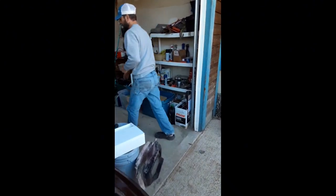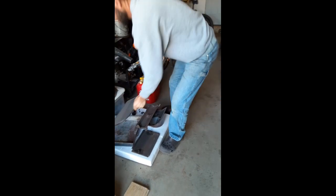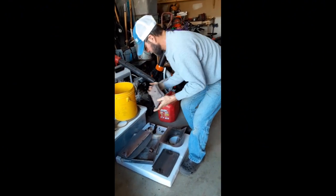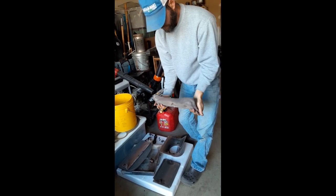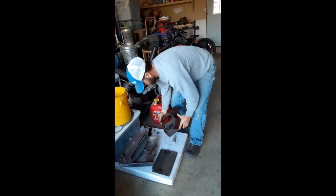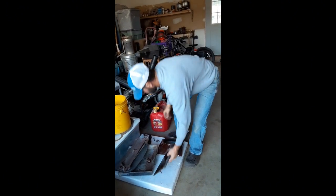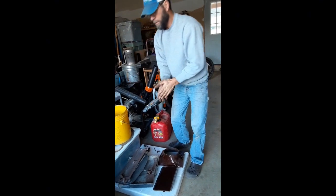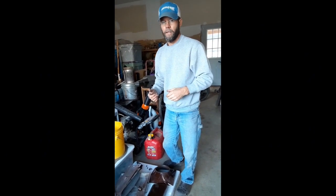Here are some parts you'll want to take out. This is the ash pan. This is the griddle top. This is a support that keeps the lower fireback in place. This is the actual dampener — it goes down and folds back up, and it marries up with the upper fireback. As long as this is in good shape and isn't warped, you can reuse it. This is the top of the stove, the collar for the flue. Then this is just a little plate that goes on the back of the stove. You also have these little pieces called andirons — that's what holds the firewood in place. I also pulled the door off, and I'm going to show you how to install a gasket on the door with glass.